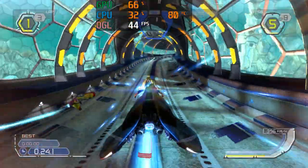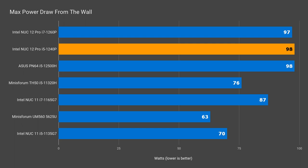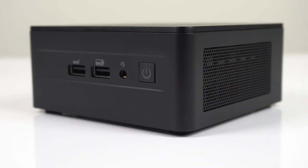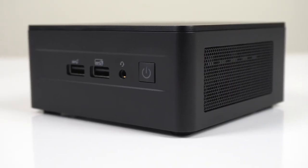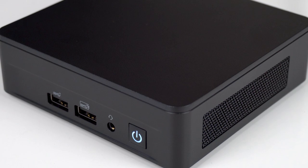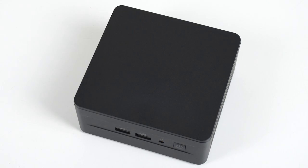It's clear the 12th gen CPUs are very capable. Idle power draw is the same as the other 12th gen units, and pretty much the same for the recorded maximum. Considering the extra wattage, it's good to see the i5 able to keep the same CPU temp as last year's unit. While the i5 NUC handles the heat better than the other two, it still power and thermal throttles — just not as much. The tall unit may help with cooling given its extra surface area, though I haven't been able to directly compare slim and tall versions with the same CPU.